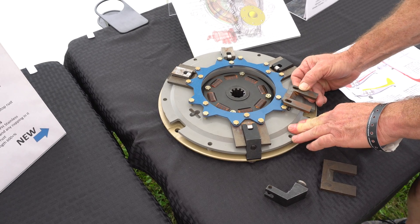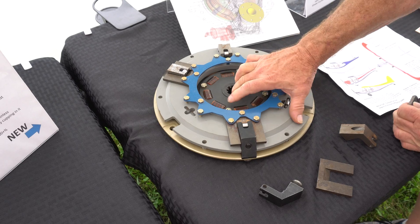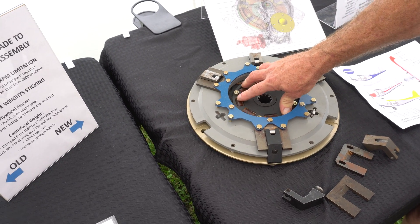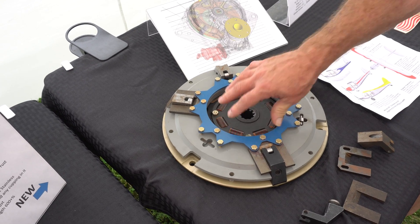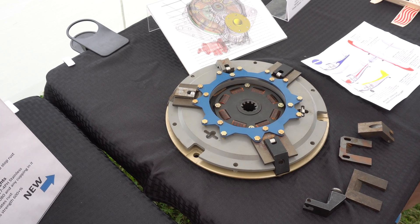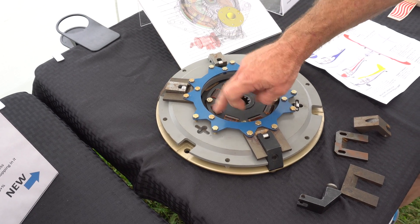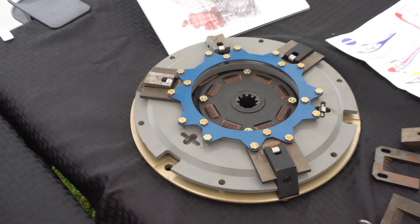When it pinches, it puts pressure on a pressure plate and engages the clutch. So what RPM does it happen at? 800 RPMs — right at startup, and it'll stay. If you look in here, it's like — I used to race cars for Chevrolet years ago. When Hayes came out with the drag racing clutch, there's no slip — it's either in or out. This thing grabs at 800 RPMs and stays engaged until you shut the engine off, then the prop freewheels down. We've also got polymer and springs — double dampening on the springs here — that helps with the harmonics, just like it does with the transmission on your car.